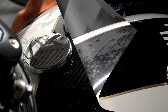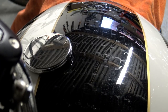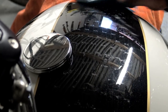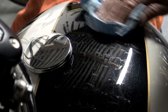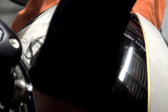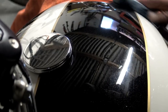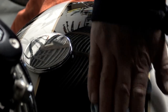Once you've got all the decals off there is going to be some residue left behind. Before you start polishing the paintwork you need to remove that, and the best chemical for that job is just a standard automotive tar remover — get rid of all the leftover adhesive so you can see the job in hand. What you tend to find where decals have been in place on paintwork is that the area around the decal picks up normal hazing and light scratches over time, but underneath the decal where it's been protected it's usually in much better condition.